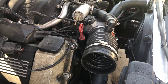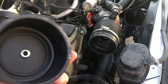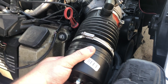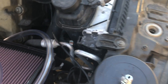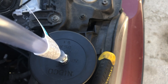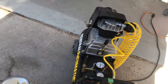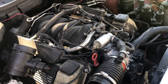I've got clear access to the intake here, and I've got this plug — a three-inch plug — that doesn't quite fit inside. I probably needed a two-and-three-quarter, but I'll just tape around that to seal it up. And as you can see, I've got another inlet there that one end of the tubing will go into. Then there's our bucket that we're going to hook up to the compressor with some smoke inside, and then we'll put it in and see where smoke comes out.